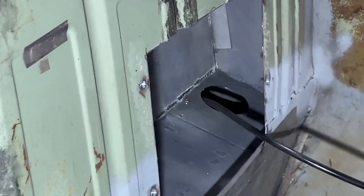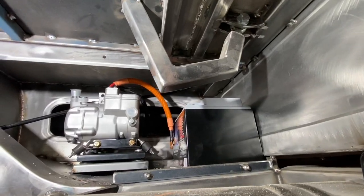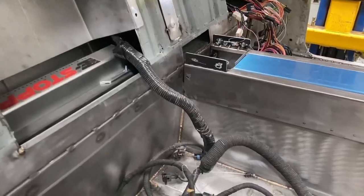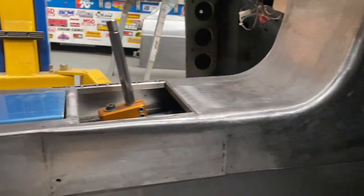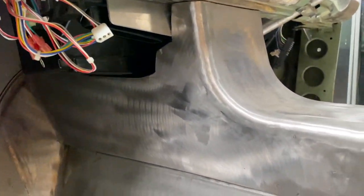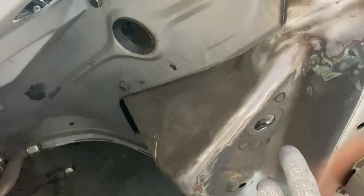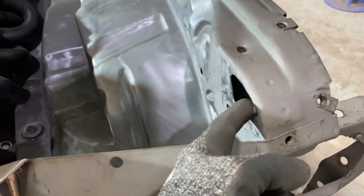Because this cavity also led into the rear under tray compartments I could run the AC lines in them. The lines would run from the electric pump housed in one of those compartments into the cavity and through the center console into the evaporator unit. The return line would run into the bulkhead through onto the dryer and around to the condenser, with those lines hidden up into the radiator support and inner guard.